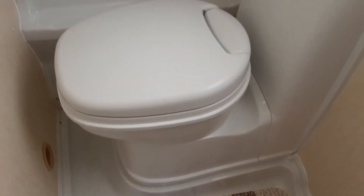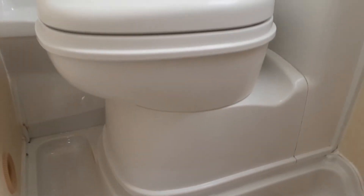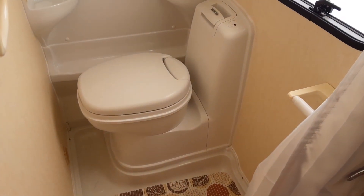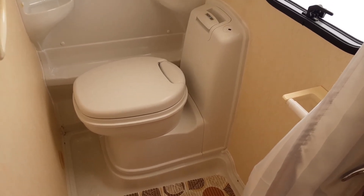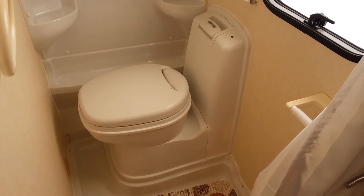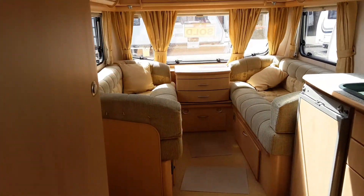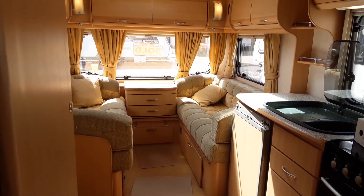If you don't turn the toilet seat to the correct position it will not allow you to remove the waste cassette. On the bottom of the toilet there's a grey waste handle on the other side — pull that towards the shower compartment to allow the toilet waste to go into the cassette. Make sure this is open before you use the toilet, as unlike a household toilet it won't have water in the bowl. When done, pump flush the toilet, then close the flap so smells don't come back inside the van. If you have any further questions on the Coachman Festival 534, please give us a call at the caravan company. Thank you for watching and we hope you enjoy the caravan.